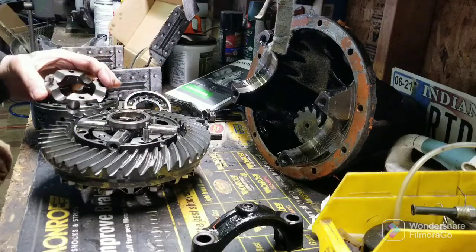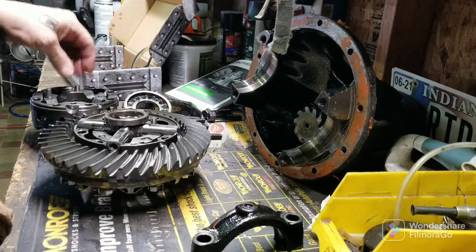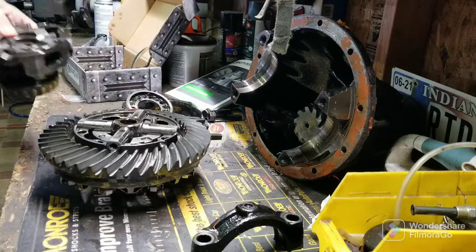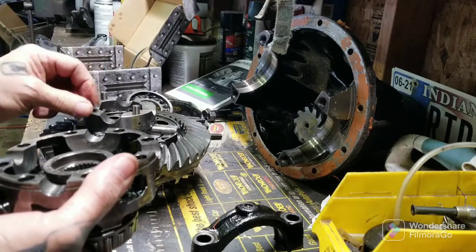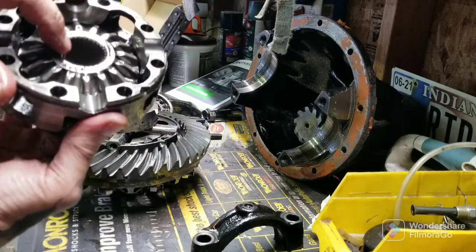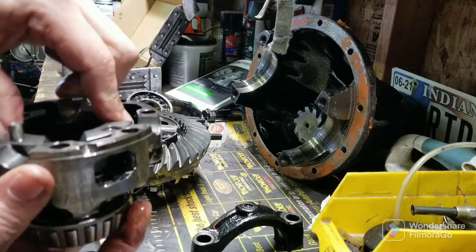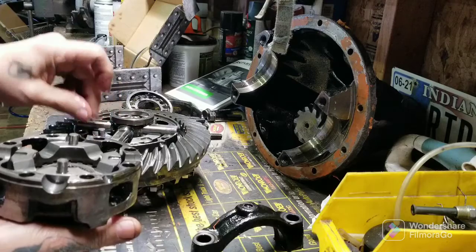I'll take my locker piece out, flip it over, and set it back in that side gear like it's supposed to be. Put your springs and your pins in their proper places, and your little center washer piece goes in there. This is all part of your Spartan Locker. You reuse this side gear that we took that thrust washer off of. Then you set this down on there — it's got teeth and angle on the back of it, and it engages that spider gear on the side. This is all greasy and gooey here, but you get the idea.